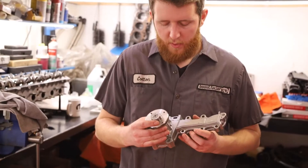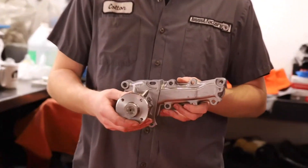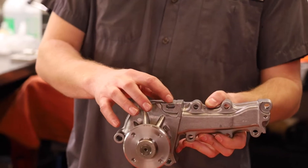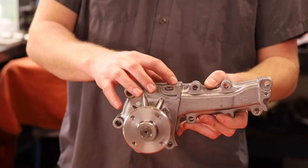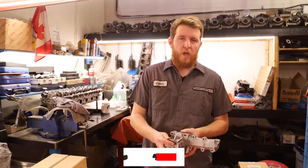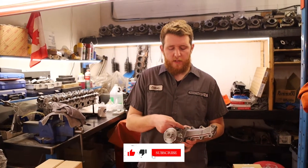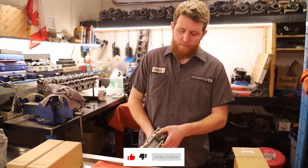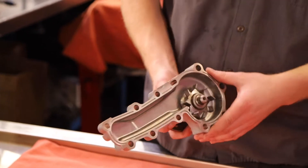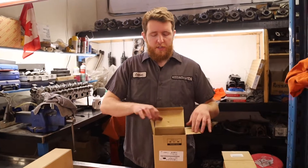The first one here is commonly used on the R33, R34 GTR, as well as the RB25 Neo Turbo. It has a small slot in the top — that is the deciding identification mark. People often put this on an R32 block as well, but they do have problems: the casting doesn't quite seal along the mating surface, which you'll see on the R32 GTR.